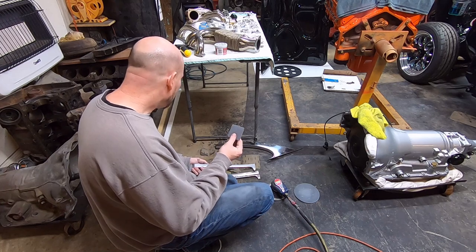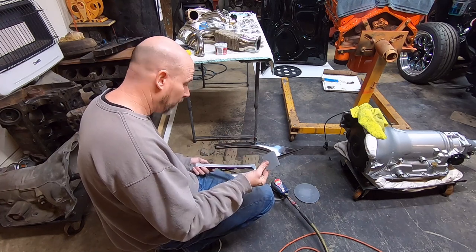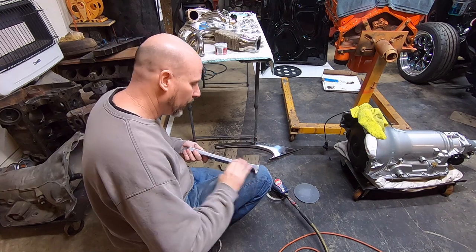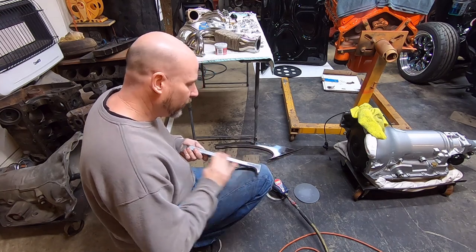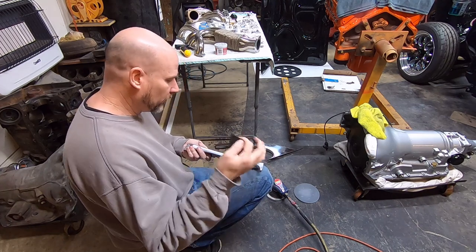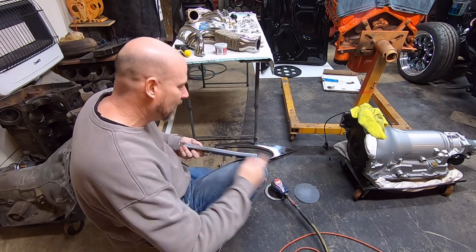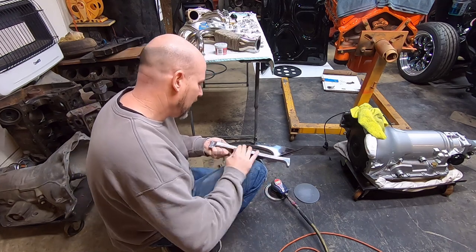So I don't have any 1200 grit paper at all. I do have some 1500 here, wet or dry sheets. So I've just went over it with 1000. Now I'm going to go over it with 1500 by hand. And what this will do is, if you're watching that right there, this will remove those little, you know, the DA lines in it, basically. This will basically put straighter lines in it, which is a little bit harder to see than DA marks.